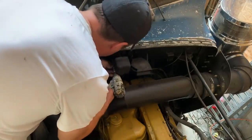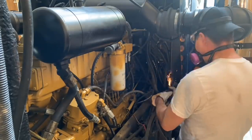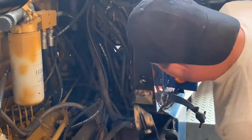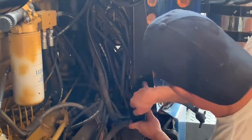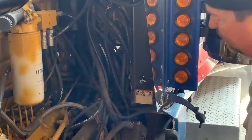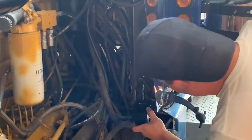A while ago I picked up some bushings for the old hood just because I assumed they were probably shot - I bought these off Amazon, they weren't too much. Now is a perfect opportunity to replace these since it's hanging here and easy to get at. This is just a polyurethane bushing kit. I need to just take the outer locking bolt off and it'll release it, take the pin out, and then I can put that new bushing in there. I'll just throw a bolt in there with a nylock washer nut to keep it from backing out.